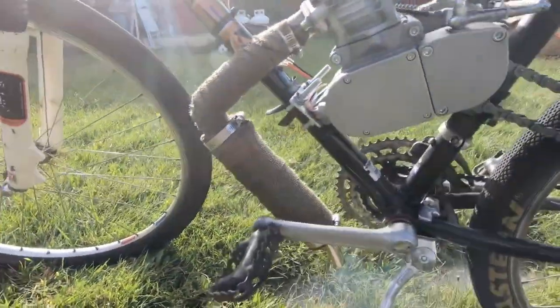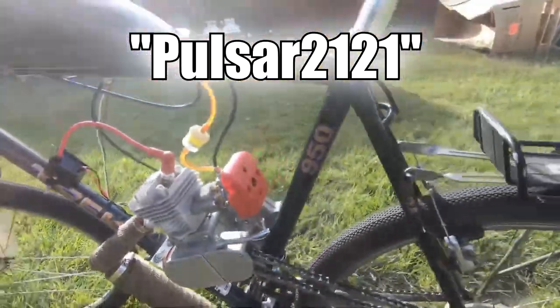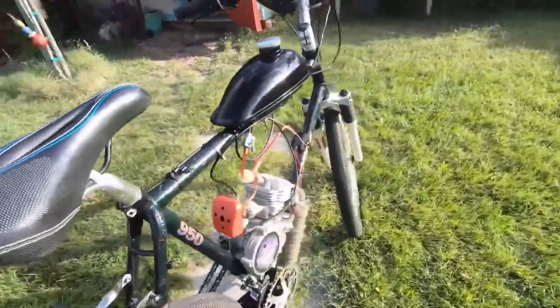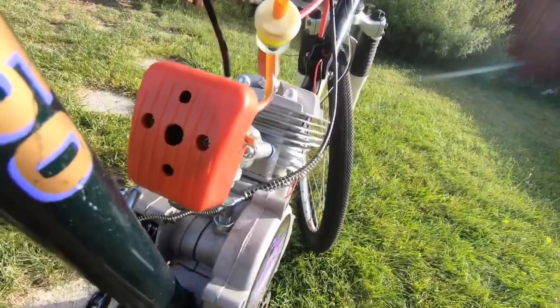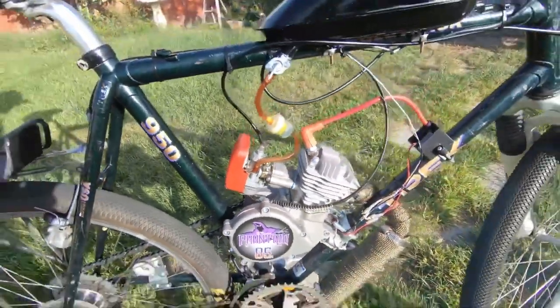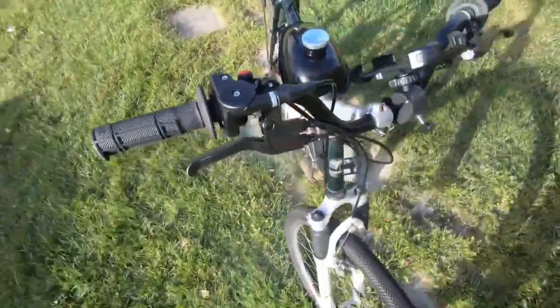I replaced the piston and sent it off to Pulsar 2121 so he could do some thorough testing on it. And it overheated on him and died too. Video's linked in the description if you want to see his series on the Phantom 85. Luckily, if it does give you issues, they do have replacement parts available for it now. Jugs, pistons, exhaust. But if you're a new builder, stay away from the Phantom 85. These things are a disaster.